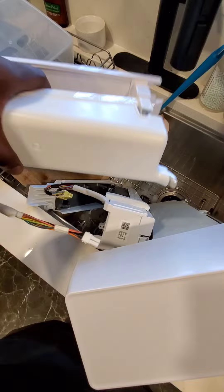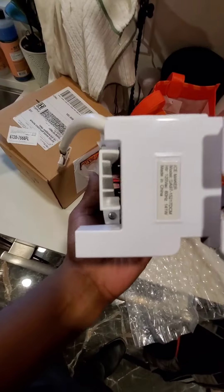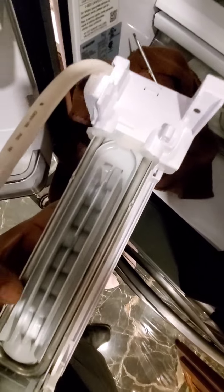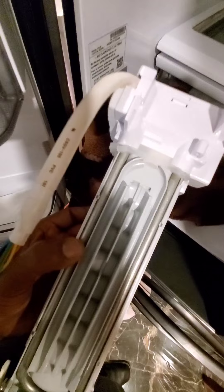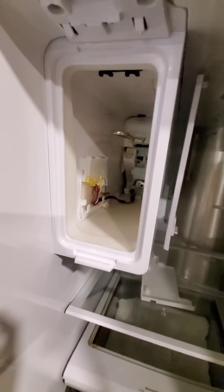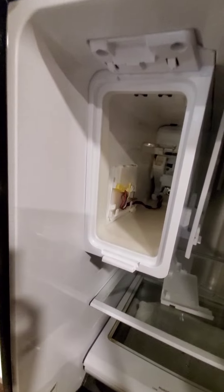Here's the new ice maker. There's a heating element assembly here, and this slides right over that evaporator coil. The heating element stays on like it's in harvest mode, and the evaporator coil stays frozen and the fan motor stays on, which creates the ice room sweating-freezing condition. So this is the real fix for these issues. Now line this ice maker up like such.